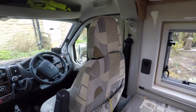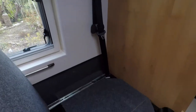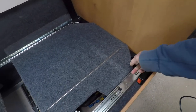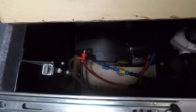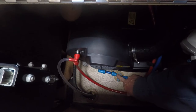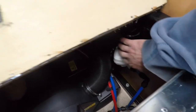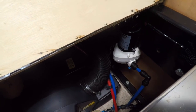So here we are back on the other camera. Just to orientate ourselves — under that seat there, that's where the boiler unit is. And if we just lift this flap, this gives us access to the two vital things. Number one is this drain down valve here, the yellow lever — up is to drain, down is to close. And as a point of interest, this lump here is the water pump. That's what you're going to hear tapping away, and as you can see there are various pipes connected to it.